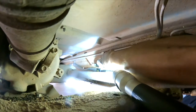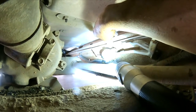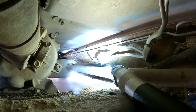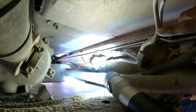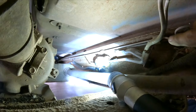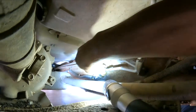Wow, that fuel smells really old. I don't know how long ago they replaced this fuel pump and fuel tank, but the fuel smells old — that's not good. Because when you have bad fuel it can damage your new fuel pump, so I'm going to have to talk to them and ask.